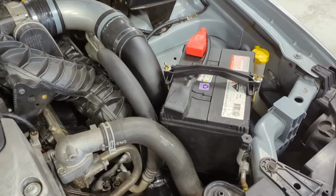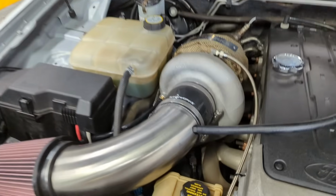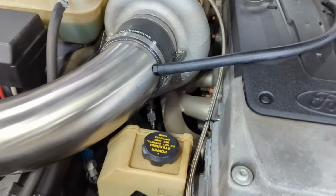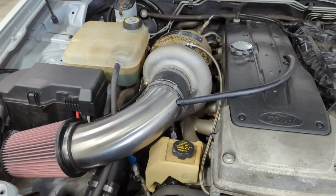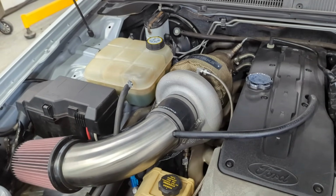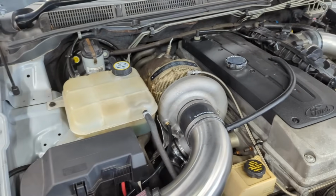Using the Process West battery relocation kit, and then we're using the Artec cast manifold, which we get through Platinum Racing or PRP. Really good manifold, exceptionally good on the boost control. We're using that with the 50mm Turbosmart wastegate, and on our baseline we've got a 5-pound spring in it, and we're seeing like 4.2 pound of boost. So super happy with that.